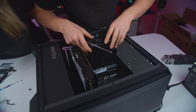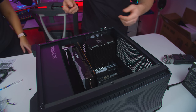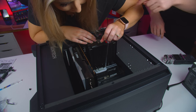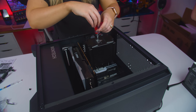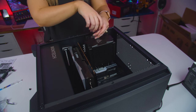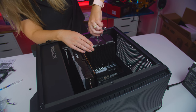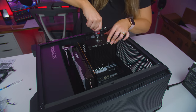All right, let me line this thing up. Do you get it? Yeah. What do you mean? What was I doing wrong? It's in. What? No. Do the other side. So you should do a couple of turns per screw. You gradually do it up tighter so that the thermal paste spreads evenly. Not that it hasn't spread already because you have missed a few times.